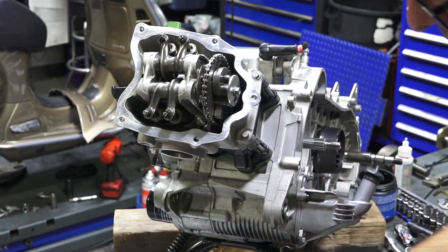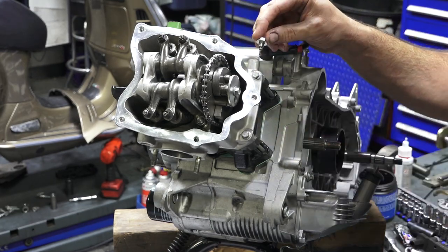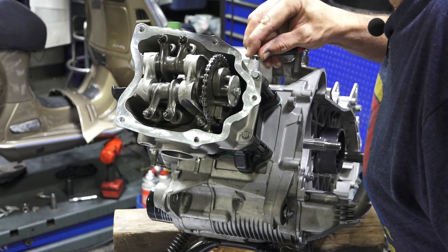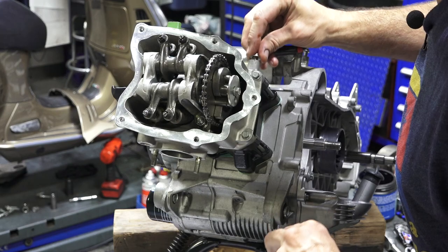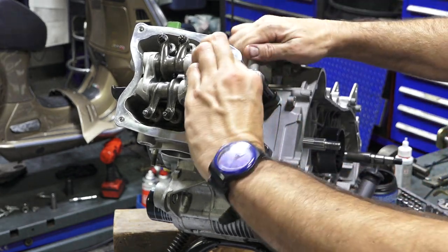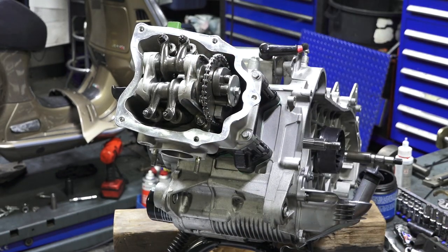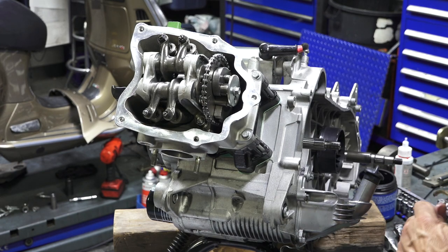So there and there, drop the small spring down and just listen very, very quiet. You'll hear the that little ratcheting motion was the cam chain adjuster adjusting to its correct tension. So now there's no free play in the cam chain. And as the cam chain wears, it will, you know, one click at a time, adjust itself.